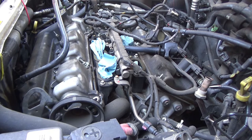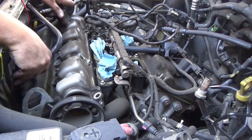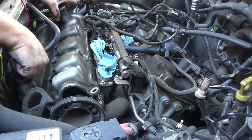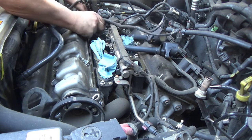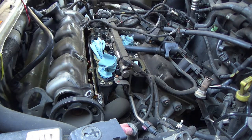One that I don't quite have out enough. Can't tell which one it is. Go ahead and try to remove these. Now, the little rubber grommet kind of wants to hold them in, but if you remove at least this one, that's going to help out, because there's a lift point here, not a motor mount, that gets in your way. The dipstick will get in your way, it looks like, but you can overcome that. In fact, I'm going to take this dipstick out.